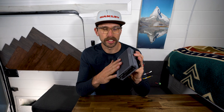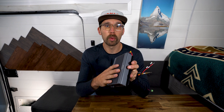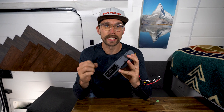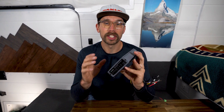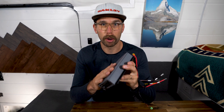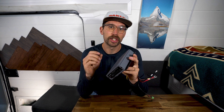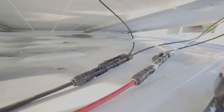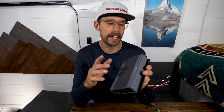The best tips I have when installing this: make sure you have put all the proper fuses in the right locations. For the wire going to your alternator, you want to install a fuse on the battery itself if you're connecting to the battery. Some people connect straight to the alternator — either way, make sure that fuse is located as close to the power source as possible, and don't locate the fuse near the charger. Also make sure your solar components are fused — you can install an inline MC4 connector fuse on the positive wire, which is what I have.